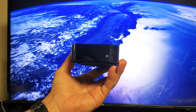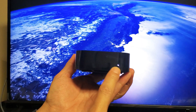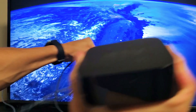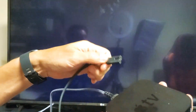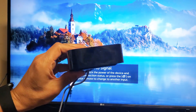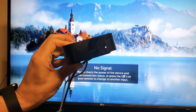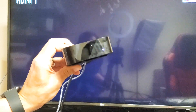The next thing we're going to do is pull the power cord out of your Apple TV. You can see my Apple TV is on by the solid white light. While it's on, go ahead and find the power cable and pull the plug. Leave it for 10 seconds. After 10 seconds, plug it back in, wait for everything to boot back up, and then open up Hulu and give it a try.